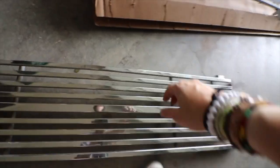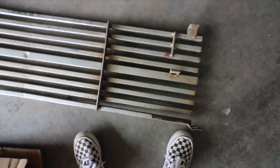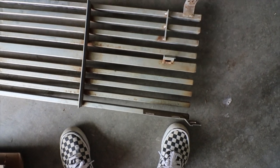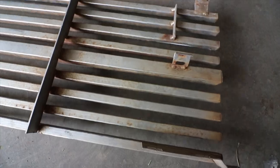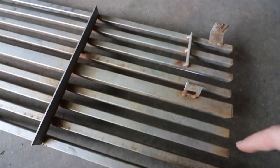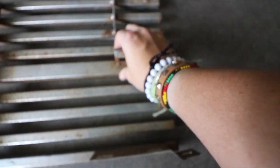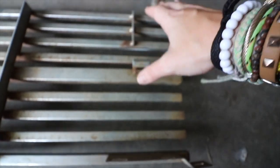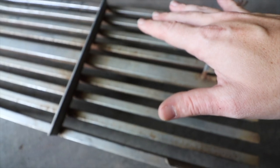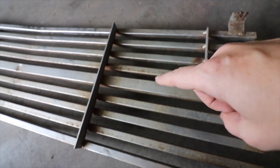Here's what it looks like all out — this thing is heavy duty, probably 15 pounds. So the screws up top are accessible when you open the hood. Then I had to get to that weird screw on the side, and also there was a tab I had to slip a screwdriver into and move up because it goes over the little fog lights and keeps the grill from moving. After that I was able to slip it out, and now we're gonna work on getting the new grille in.